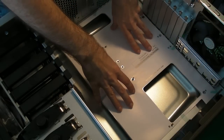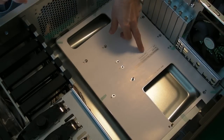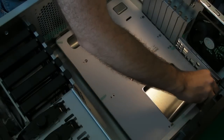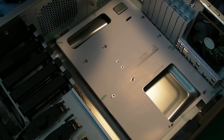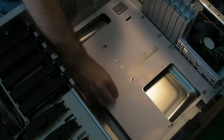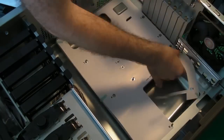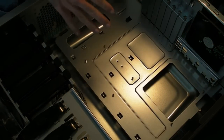You can also see there's a template here which tells me where to put the mounting screws for the motherboard. I'm using an ATX case so I've got to put them in these marked positions. I've got a little bag of thumb screws here, and it tells me to put one in A, another in B, and one in C. And now we're ready to offer the motherboard up to the case.